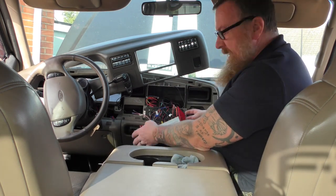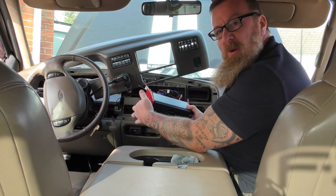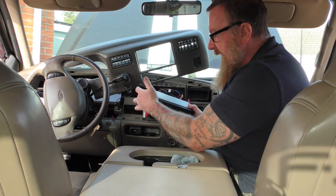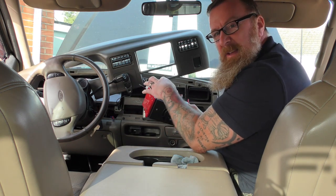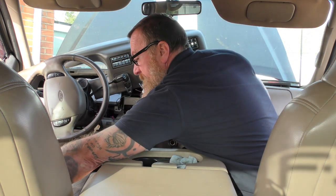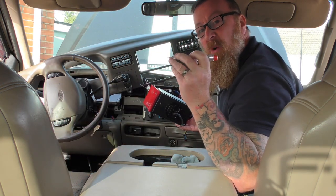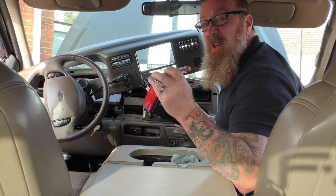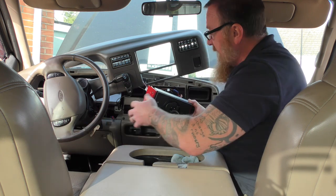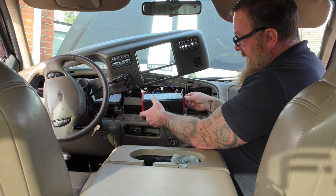So this always looks a little bit of a mess. I put these on the side to bag it out. Be careful — there are screw holes down the side here. Make sure you fit the correct screw; don't just stick any screw in because there are all little bits in here. So test it with the screw first. I've got a small screwdriver like this one and I poked in all the holes — some went right through, some hit things. You don't want to just be drilling them in; you're going to wreck your stereo straight away. So test all the holes on the side and then fit the wadding in, and it nicely screws in. I've got some self-tappers to go through the plastic and into there.